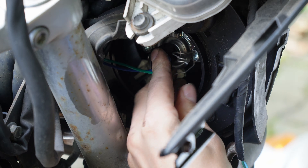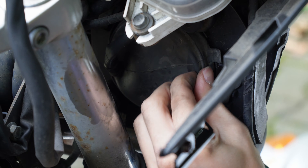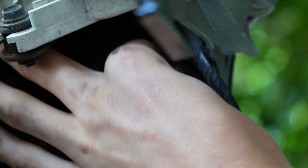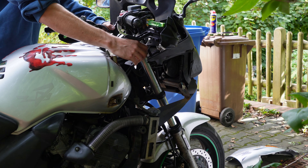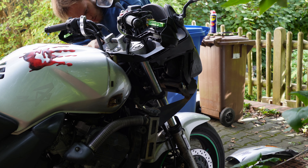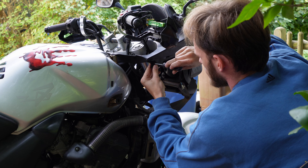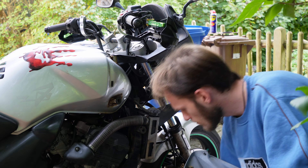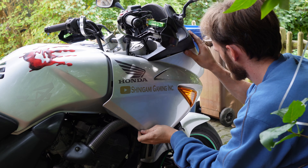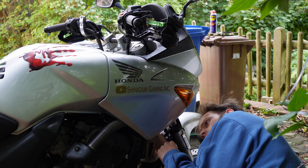This time I got an even better shot of it. I also have to change the small position lights in the corner. These are just held in by rubber, and if you locate them it does not take much to wiggle them out. The light itself is also quickly pulled out. If you are switching to LED lights, make sure to check if the LEDs are working because they are directional.